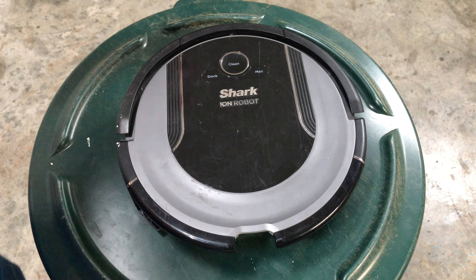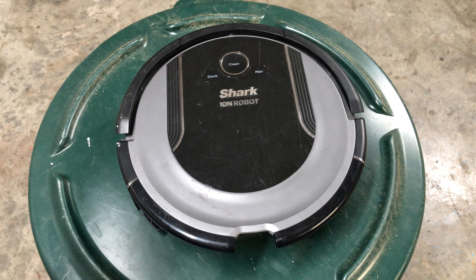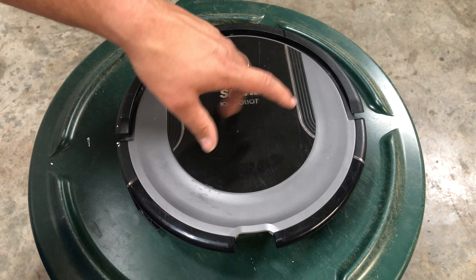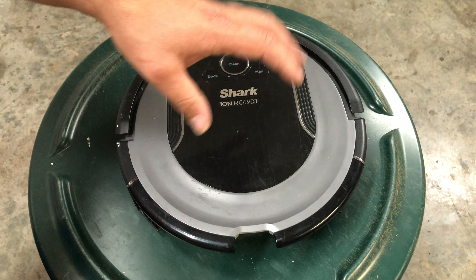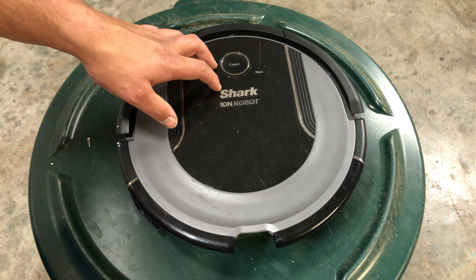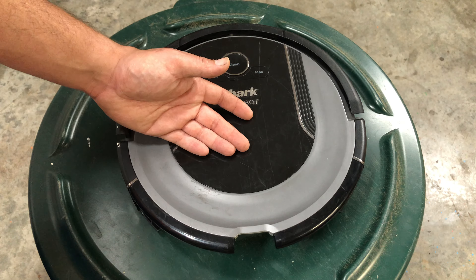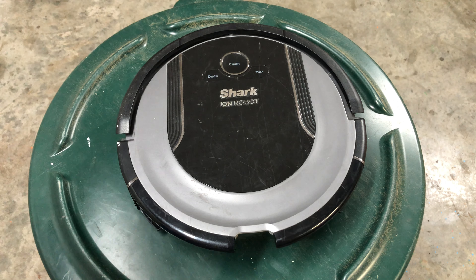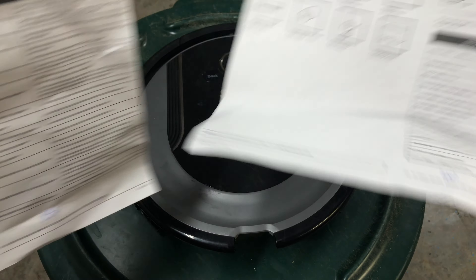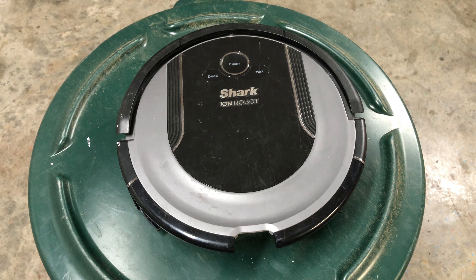Stick to an 850 battery; a 725 or 750 battery will work if you can't find anything else. It'll be labeled a '700 in' battery or an '850 battery.' The 700 in battery was used through the 700 series — that's the old model that did not have removable wheels. Now, the reason I'm making these videos is not everyone has their manual. Every robot is different: the 700, 725, 750, 850, and thousand series are similar but the actual errors are a little different.